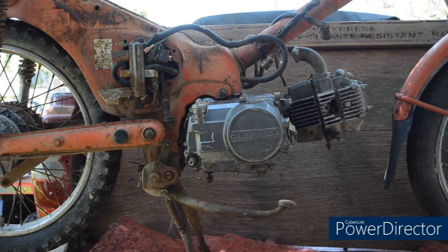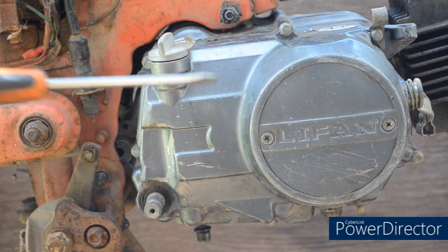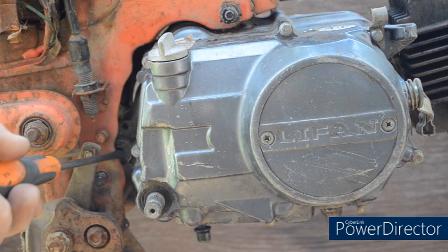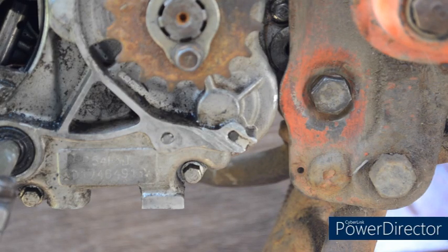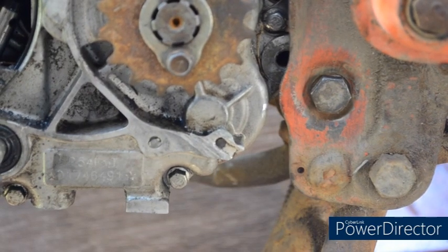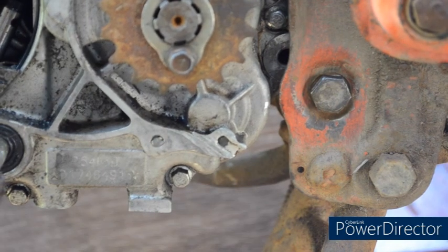I've loosely fitted the Li-Fan 125 into the CT110 frame — let's have a closer look and you can see the difficulties you'll face when doing this modification. The engine's just loosely held in with the 8mm bolt supplied with the Li-Fan, and the engine will be sitting just a little bit lower because the normal Honda bolts are M10. You can see the bottom mount is a long way off and the contours of the frame don't match. If you buy the adapter plate from the internet, that will take two plates and bolt onto the footrest mounts. I'm not happy to do that — I'm trying to work out a way of utilising this rear engine mount onto the standard mount, which I think will be a much better way of doing it.